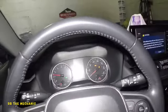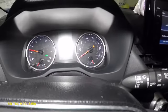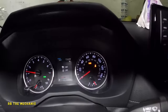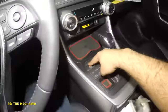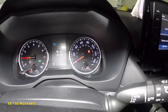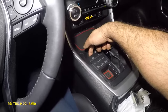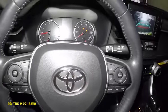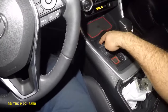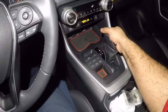It's going to wind back and then stop. Turn it off — the parking brake should turn off. Put the parking brake on, the parking symbol should come on. Turn it off and on several times so it calibrates. Put the parking brake on and go to reverse — the vehicle shouldn't move. Take it off and it should start to move. Thanks for watching!